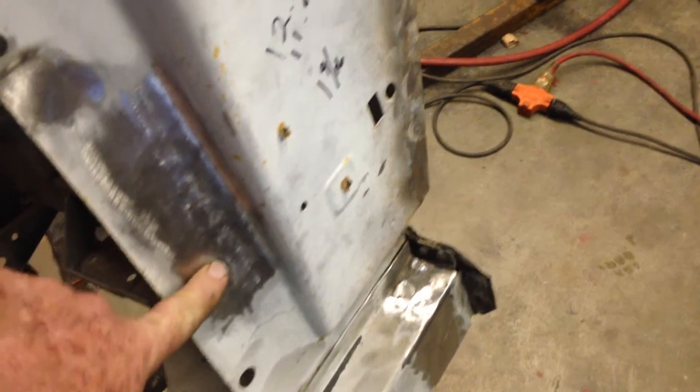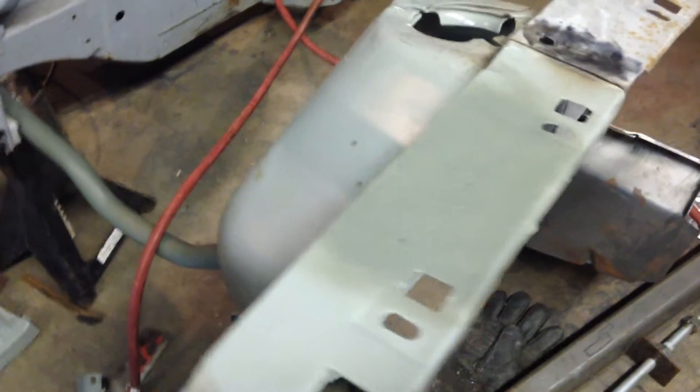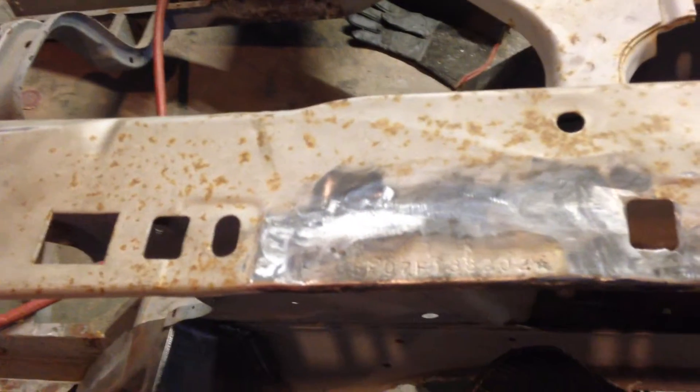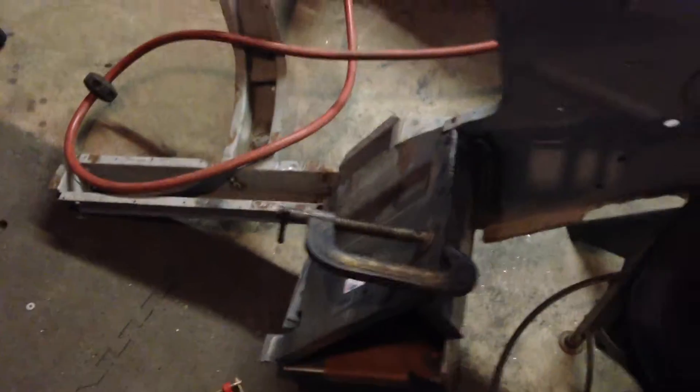There were two holes, about an inch and a half and an inch and a quarter, roughly here and here. Today we moved the VIN number over — can't really read it but we moved that one over. And this one back here, you can see where we ground off the welds. So we've got the car back to what it was. We've also added the torque boxes off of a '68 to the back end here.